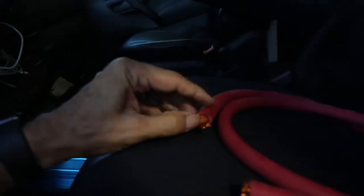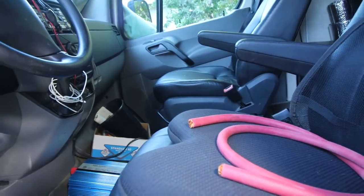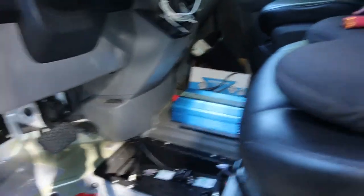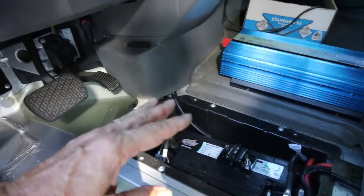I'll keep you informed as we go through this. One of the big things is the crimping of those cables — you want to have a good connection. You don't want an okay connection where it gets hot because it doesn't have enough current going through the whole wire. If you have a loose connection it may only be going through a little bit of the wire and then it's going to get hot, and that is not a good thing when working with voltage. Also make sure the insulation is not going to be severed by something that touches ground.